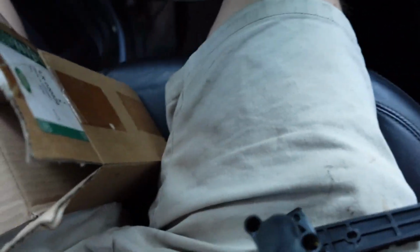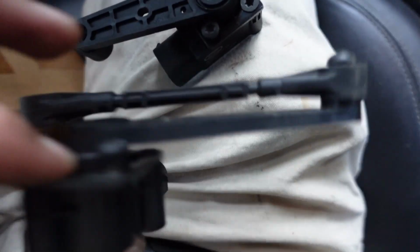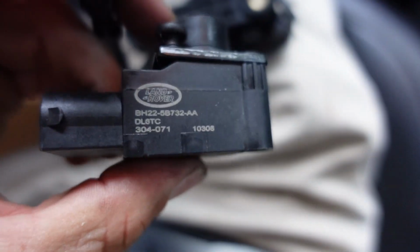Got a couple level sensors here that I had laying around in the parts bin collection. Let me run the part numbers, see what we're working with. Pretty much guessing that it'll be for the two that aren't causing issues right now, about how it goes. Just on the old Google, and you wouldn't believe it, we have one front, one rear. So at least with these around, we can do some easy troubleshooting. I'll just swap the sensor and see if that goes away.